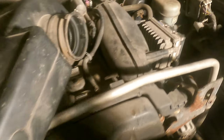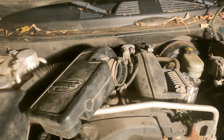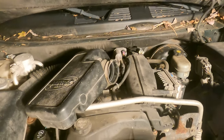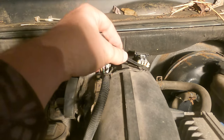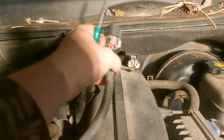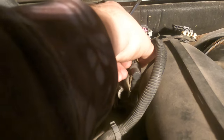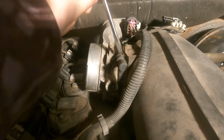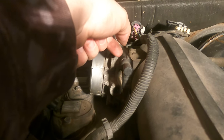Next I'm going to get this clip off, and then there are four bolts on the throttle body — looks like they're probably a 10 or 12 millimeter. Pull those off and the throttle body should come right off nice and easy. When you unplug the connector from the throttle body, watch out because it kind of tees off — you don't want to jerk it too far back or you might hurt it. Just tuck it off to the side. There's also a fuel line that goes here with a little clip, and I'll show you how that comes off.